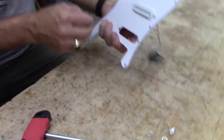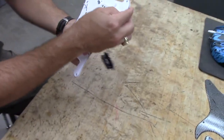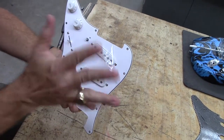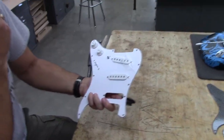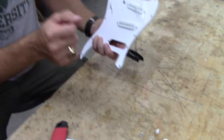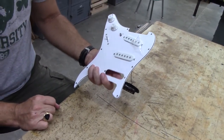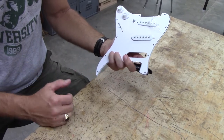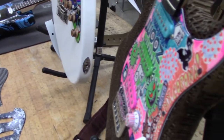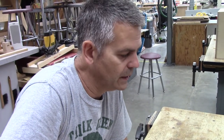So you can just take that completely apart. Make sure you peel off all the mastic — this appears to be a single layer, but sometimes there's two, so watch that. Scuff sand it — 320 would work fine if that's all you've got; I kind of like the surface finish of 400 grit. And then put a clear coat on when you're done. Really any clear will do — it depends on what you want to spend. You can spend 20 bucks for a super durable automotive finish, or a catalyzed two-part urethane clear that is bomb-proof. Or you can buy a $5 can of clear enamel and just put several coats on it.